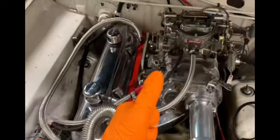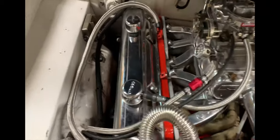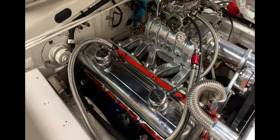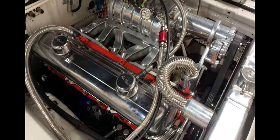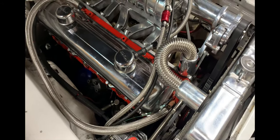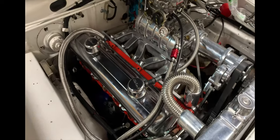Here's something you've got to be wary of: when you have something nice, people will hate you for it and mess with your car. So if you're going open hood, keep an eye on your ride. People will literally mess with your car — it's happened to me before. If you're out doing more than just a little cruise, if you're going to stop and get groceries or food, always give everything a look over — your hose connections and ignition connections. If something feels off and it's not running right, there's a chance somebody pulled one of your hoses — PCV, vacuum, whatever. Clamp your hoses and keep an eye on the state of everything when you're out in the world.